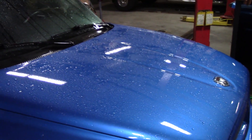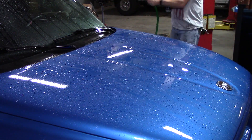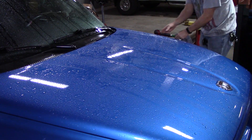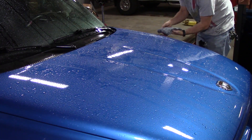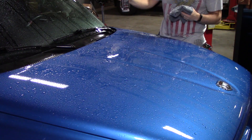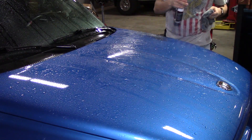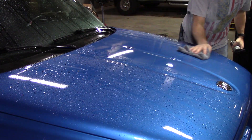Sorry about the sniffling — it's cold here in the shop, only about 45 degrees. So what you're supposed to do is get your gray towel wet and also have a drying towel ready. We're going to get the gray towel wet with water and wring it out — you don't want it soaking wet. Shake the bottle up because it does separate; paint sealant separates, so shake it until it's gray all the way around. Then we're going to mist it onto the paint. The water is already just running off. You work it gently into the paint — you're not rubbing hard, just making the towel glide across the paint.